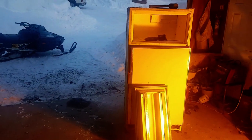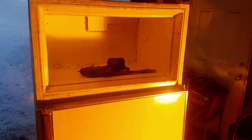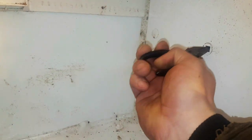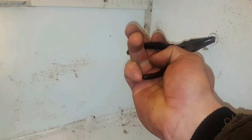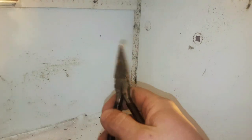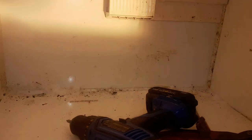Today we're going to turn this old refrigerator into a smoker. One of the nice things is to find an older one - knock off one of these little tabs and you see pink or yellow insulation inside. That's easier to clean because newer ones have rigid foam that's really hard to get out. We'll pull out any screws, peel this out, expose it, and just have a metal box to use as a smoker.